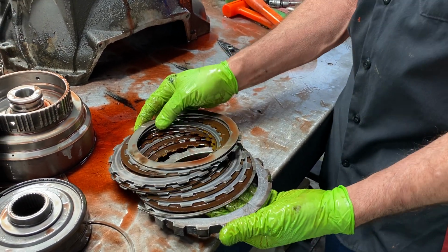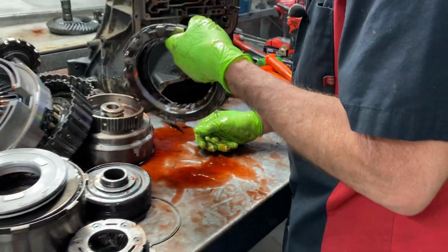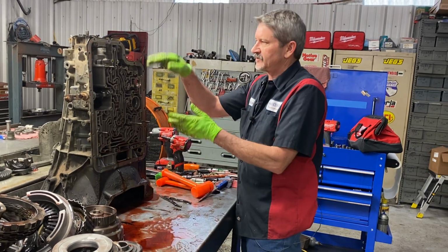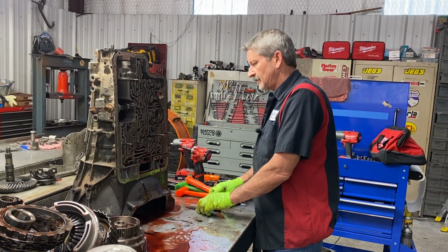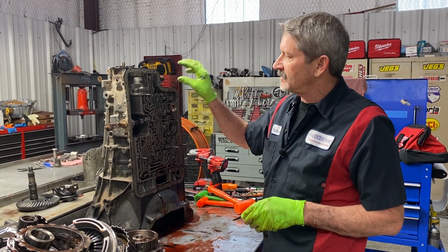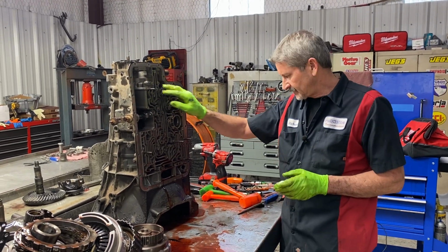This tranny's really bad. It's got so much to do to go into reverse. You got your third gear clutch coming on, your low reverse clutch coming on, and it's such a big circuitry that there's a lot to fill up to make it happen. And the delay, to me, always occurs in the low reverse clutch area.